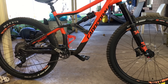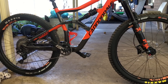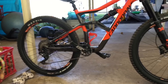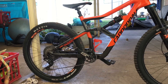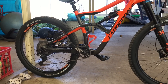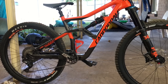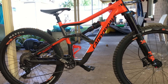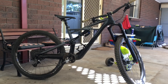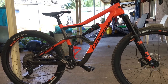Also just fixing my friend's Cannondale here — this is the Cannondale Trigger, I believe it's a 2018 model. Carbon, 34s on the front, it's got a Gemini rear shock, Fox Float — super playful, wicked bike to jump around on. 27 and a half wheels, XT at the back. The cassette is a little worn — it has a bit of trouble going from second to third — and there may be a slight twist in the derailleur hanger, but not major.